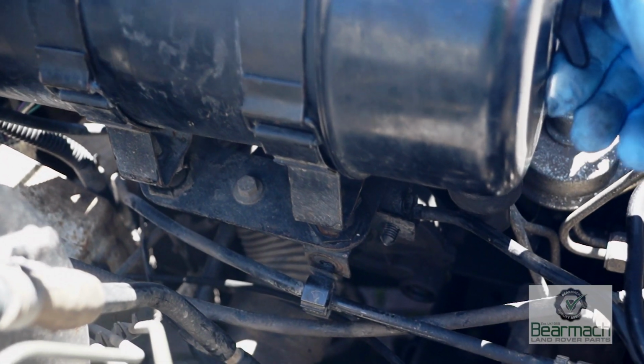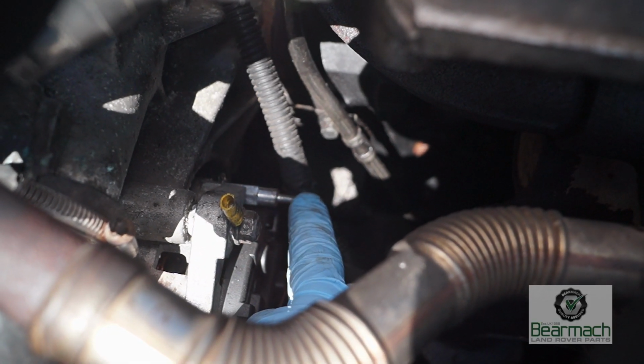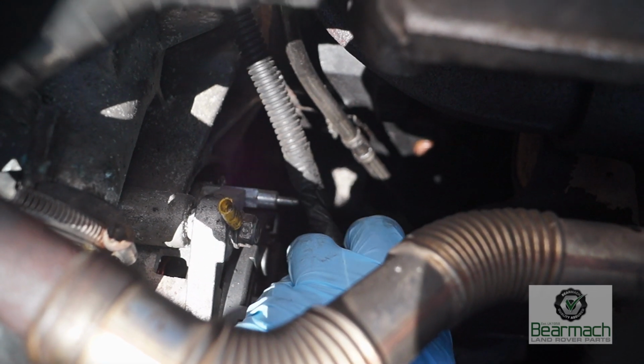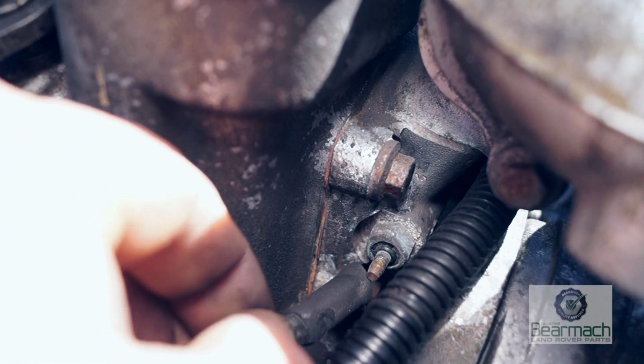We seem to be getting quite a big list at the moment. So we've got the air filter that's got a broken rubber bobbin. Also have a loose bolt here and the loom. There's a chafed alternator wire. This could cause actually serious problems with your alternator if it wears through and shorts out. Also, electrical connectors are worth checking to make sure they're not corroded.